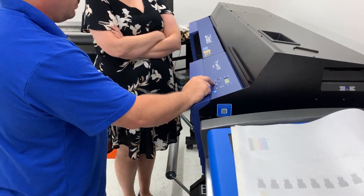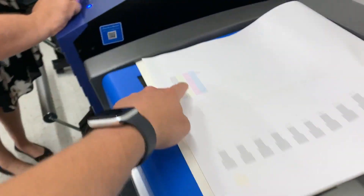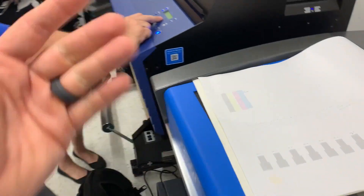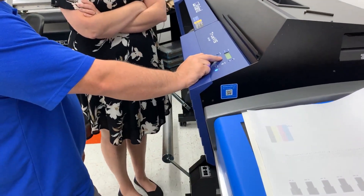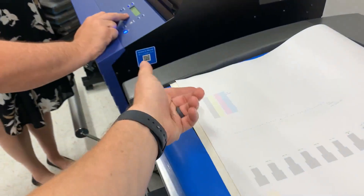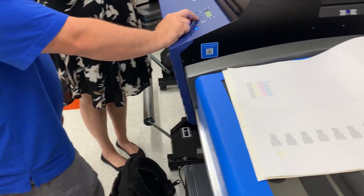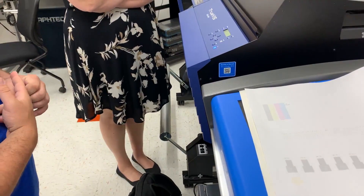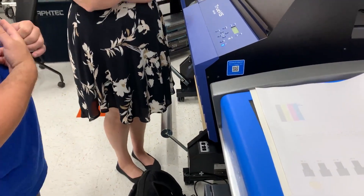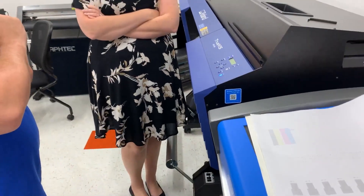The idea is basically, if we're making progress with the normal, don't move to a medium. So if you see dropout on your first test print, run a normal. After the normal's done, do another test print and see where you're at. If fewer lines are missing, and it's just one or two, you're probably okay to print. If there's still 12 lines missing but it used to be 20, try another normal because the normal's making progress. Keep doing normals until they stop giving you progress.